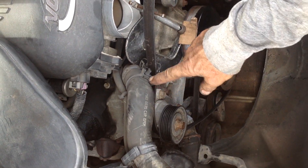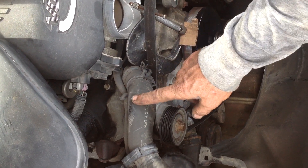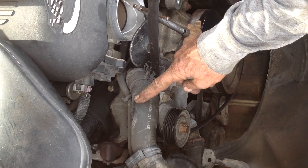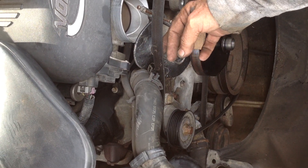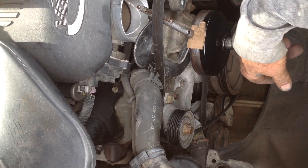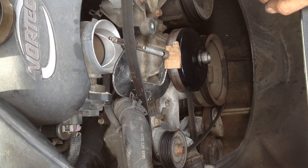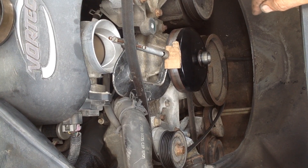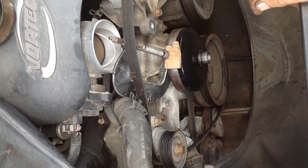The hoses all have a production date of March of 2003, so these are all the original hoses. I'm going to order the upper hose and the lower hose, and two belts — the AC belt and the main serpentine belt both need to be replaced. This was a good opportunity to see what I need to concentrate on for maintenance, so I'll put an order together. For the time being I'm going to do the clutch and see if it helps with cooling.